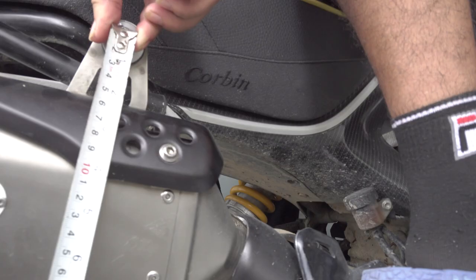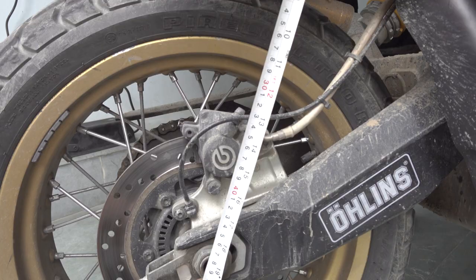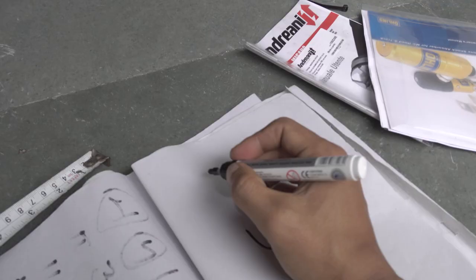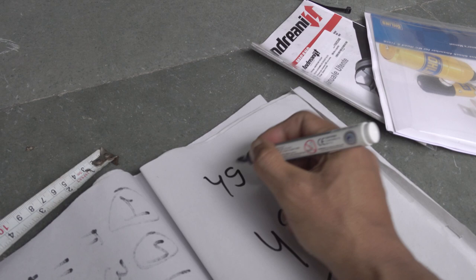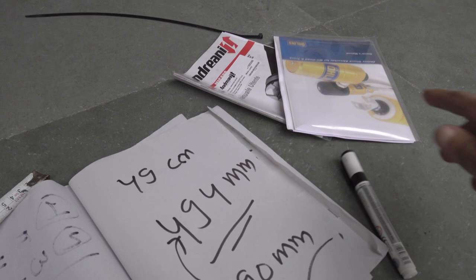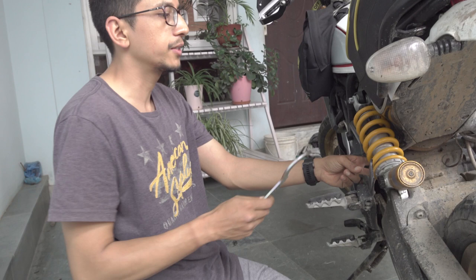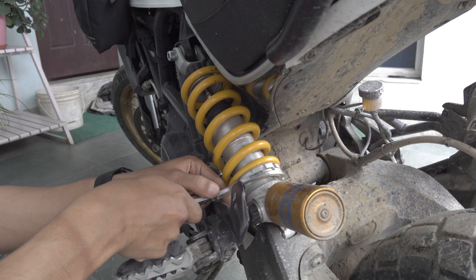So the target is 560 minus 66, which is 494 millimeters — that's what we want the weighted travel distance to be. Let's go ahead and do that. Measuring now — we're coming in at about 49 centimeters, which is 490 millimeters. That's around the ballpark of the recommended preload target, so we are done. Let's go ahead and tighten that up. Now that we have set the preload adjustment, it's ready. I'm just going to lock it and rotate clockwise to tighten it.